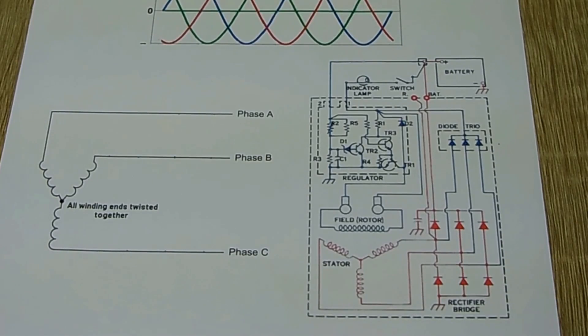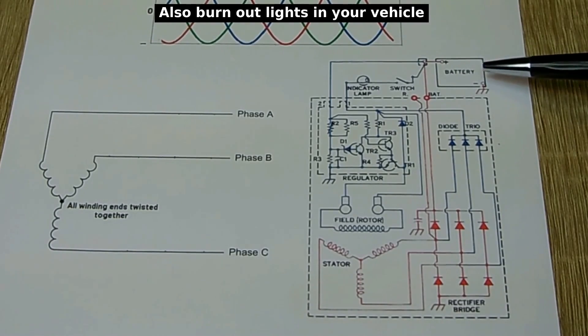In order to charge a battery in your vehicle — when fully charged it's roughly 12.55 to 12.65 volts — you need a higher voltage to push current into the battery. So most alternators have an output range between 13.8 and 14.5 volts. While idling, if you measure voltage at the alternator post or battery terminals and rev the engine to around 1500 to 2000 RPM, you should see that higher voltage. If it's above 14.5 volts, you have an overcharging condition — that's going to heat up the plates in your battery and boil the sulfuric acid electrolyte, giving off excessive hydrogen gas and possibly damaging the plates.